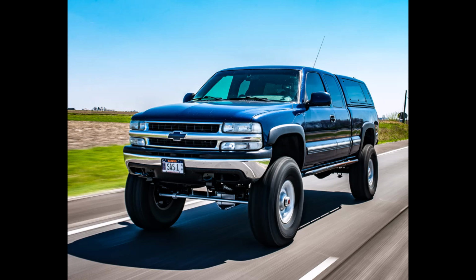Do you have it overlaid? Some of it, but a lot of it is set up against the 1/8 inch square tube. Oh, okay. So I plug welded everything. Yeah, that's nice. It's not been a nightmare at all. It's actually been pretty smooth, and it's all brand new metal. That makes life easier. Oh yeah, super easy. We're using exhaust bends that are kind of rusty already, and you're just like, I'll just grind the rust out, but then it's thinner. Half as thick. Yep. New metal is definitely key when you're trying to do something like that.